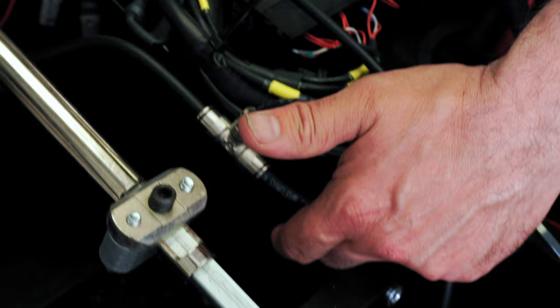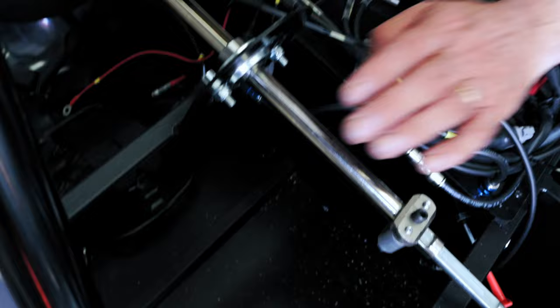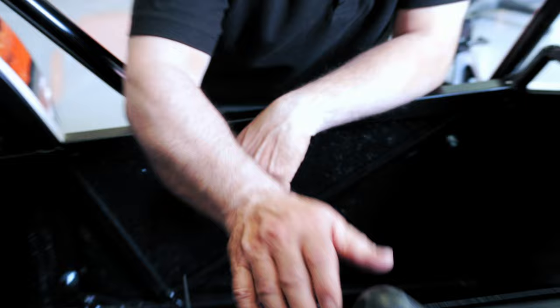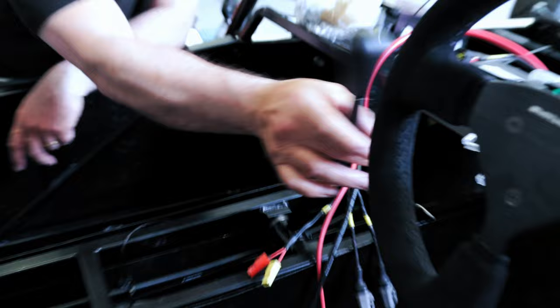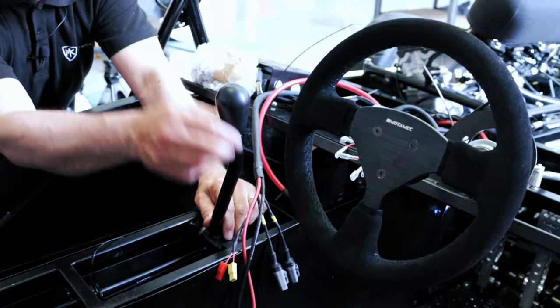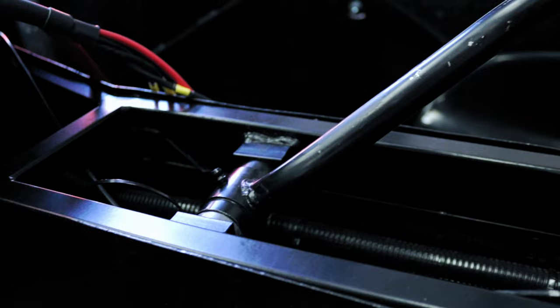The fire extinguisher system is plumbed into the passenger footwell and driver's torso area under here. You can just about see the blue anodised section — the new three-piece column that's gone in, all fitting in. The final fit's been done on that with a Go Race quick release boss. Interior-wise, we've got our side seal protectors that hold on the body panel's interior pack. The gear lever is on a bearing system — it's extremely loose which is nice. We've angled it so when the driver's seated you're literally a fingertip away from changing gear.